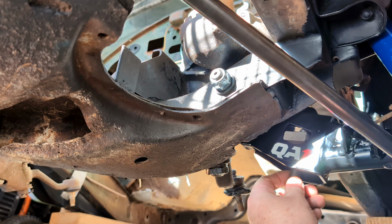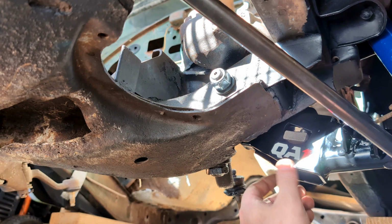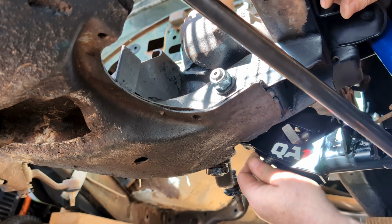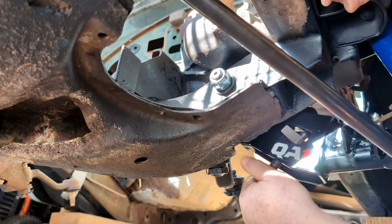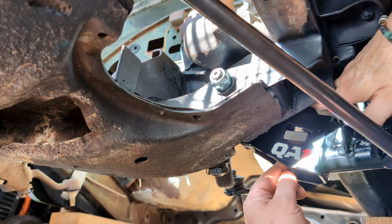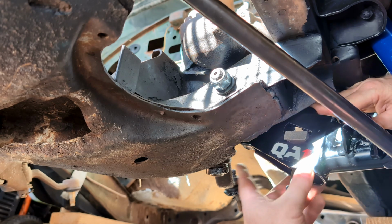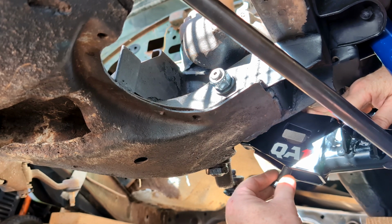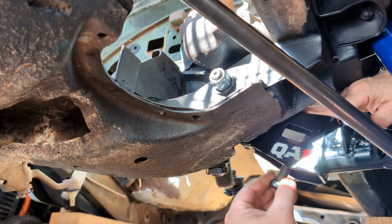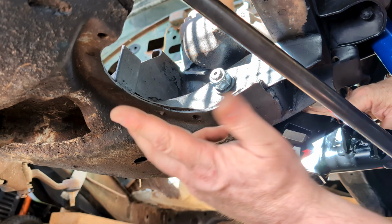Don't tighten it up too much, just so you see the top of the nut, the top of the bolt exit that flat part. I can't even really see it myself. Oh, that's way too high. All right, right there, just so the threads barely show. All right, push that down. There we go. Now it sits in the cup. The end of the bolt sits in the cup that's on the arm. Yep, you got good movement. Now torque that down. Oofda.